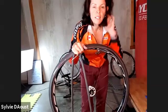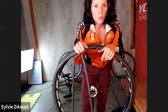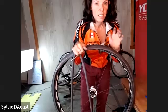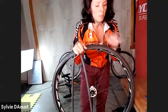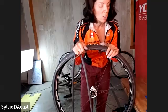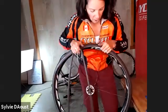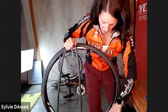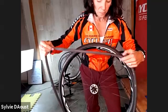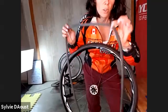Because, like I said, if it cut through, you definitely don't want to continue riding with a sliced tire, because you could blow it up. When you pump your tire, your tube could bulge through there. So you want to put a Band-Aid on the inside. Okay. Now you're also going to double check everything else, nothing else hanging out there. And then you're going to go, okay, here's the hole. I'm going to patch it.